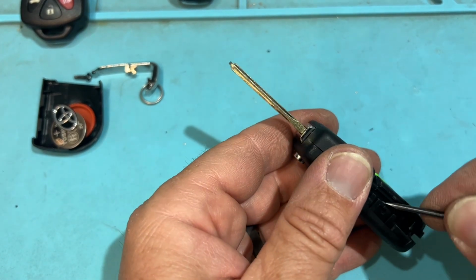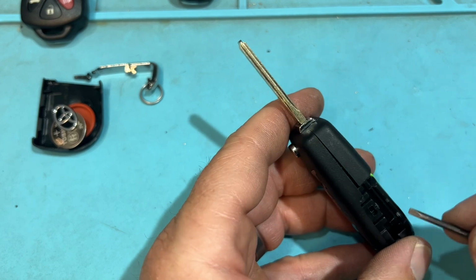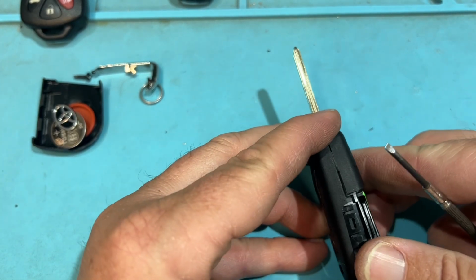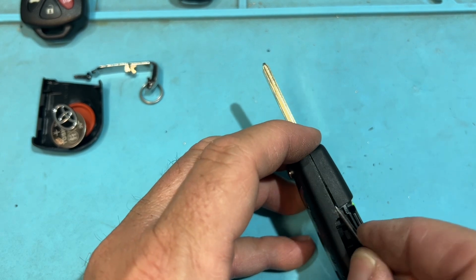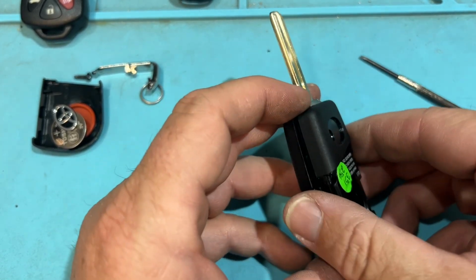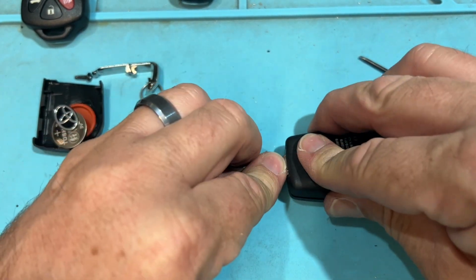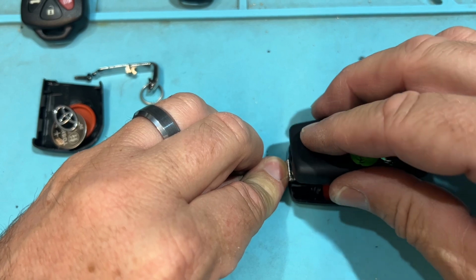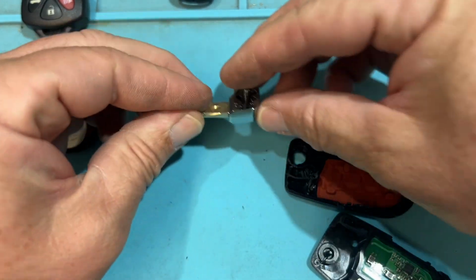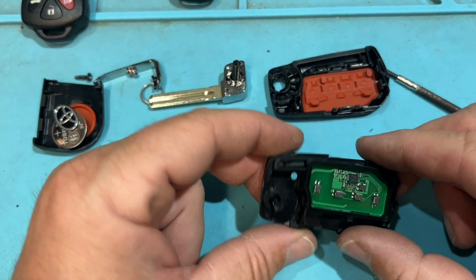And then gently pry that. Good. You want to get to that. And then you can slowly open. I'm just going to wedge a little like that, but I'm not putting too much pressure to damage and scratch. And I'm going to hold on to the spring with the key blade and up and out. Cool. Put that aside without it popping out. Looks very easy, just practice.